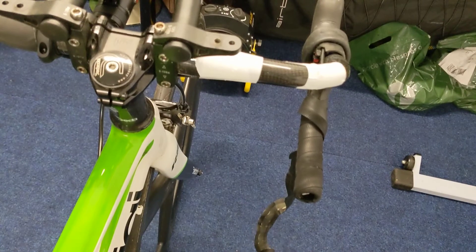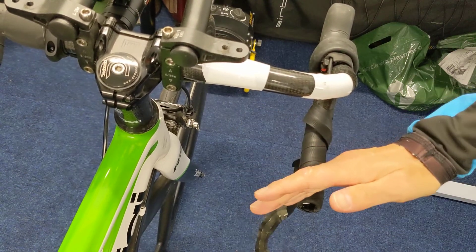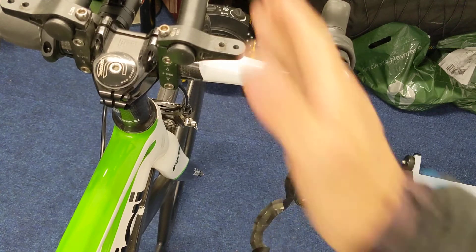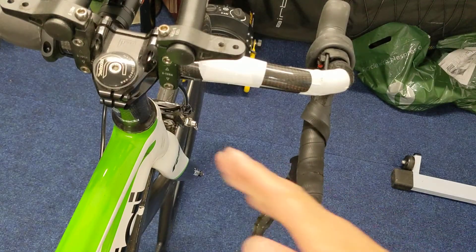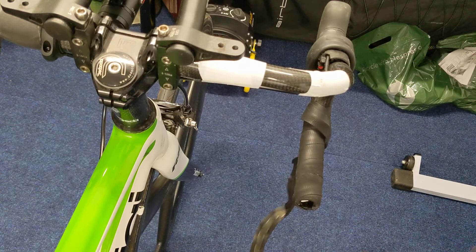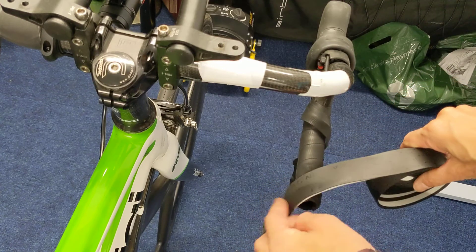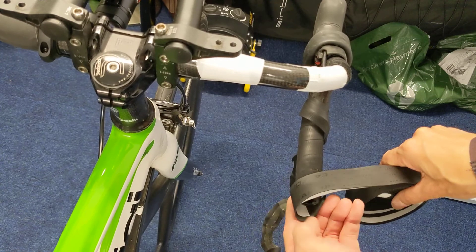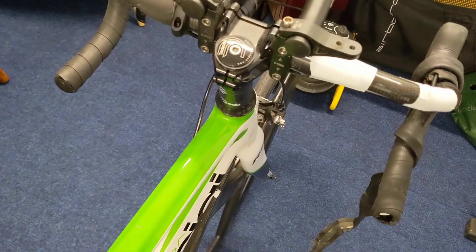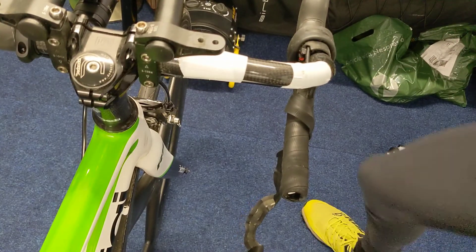The second thing you're going to want to know is that when you start to apply the handlebar tape it's got to go at an angle — so not like this, but like this. On the right side you start at this point. Of course it has to mirror image, so on the other side it goes the other way. You're going to place the handlebar tape like this — to exaggerate — and you want to leave enough so that there's something to tuck in. I've slightly messed it up, as you do. The first handlebar you do is going to be the worst one. You think after you've done anything, 'Oh, I know what I've done wrong.' So you must leave enough tape sticking out so that you can plug it with a plug.